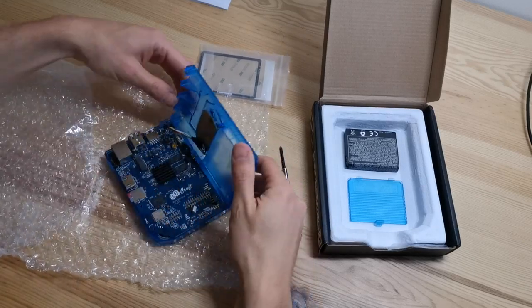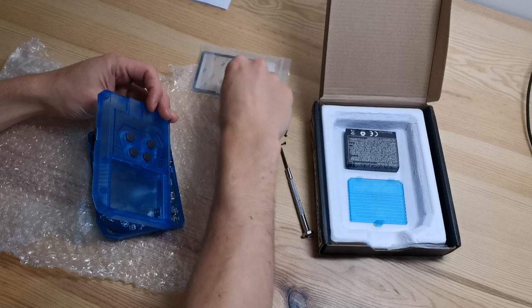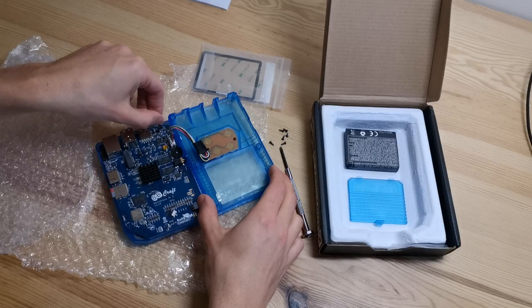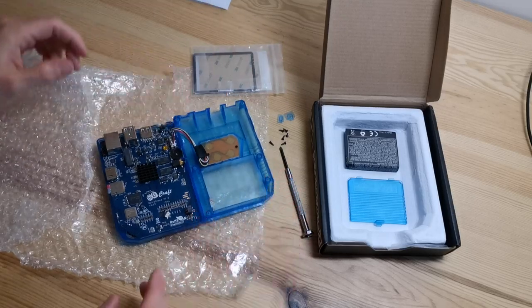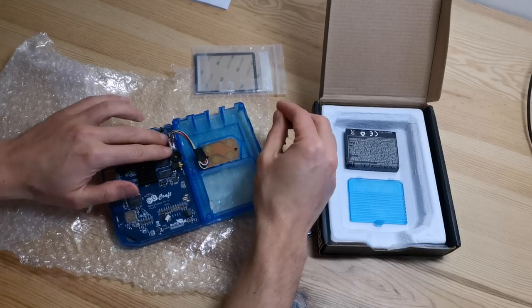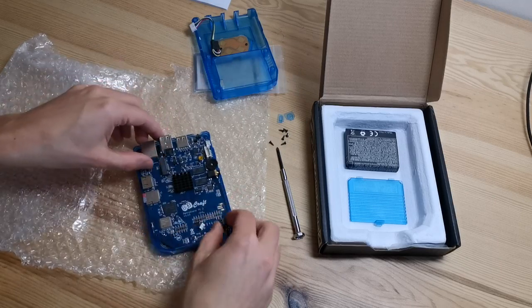Put the back case on the right side. The screws will just fall behind, so make sure you don't lose those small screws — you have six of them. The two small plastic parts are still in their slots but may move, so put them aside. For convenience, you can disconnect the back case by holding the white connector with your nails and lifting it so it's easier to manipulate the rest.